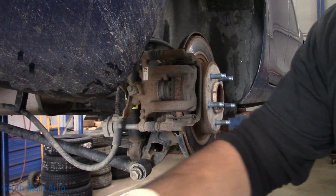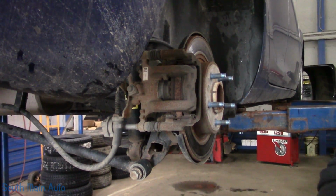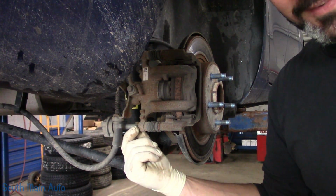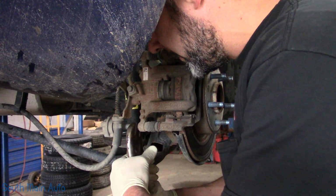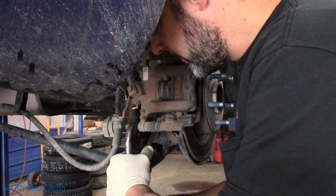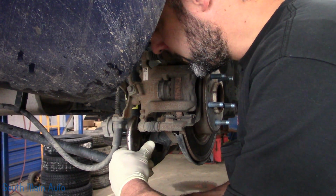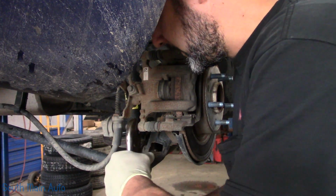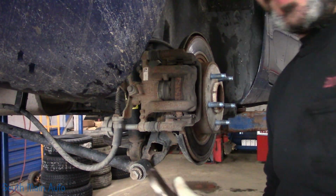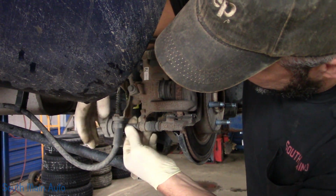So we're gonna take the brake caliper off. Now this has a little noise dampening donger on it. And experience tells me if you grab the little tiny flats that are on there, they will not come off. You just strip it out, so I use a flat pair of vice grips. Click on it good. Click on it better than I did. Just use that to break it loose. They get a little crusty on there. And it's also the lower bolt.